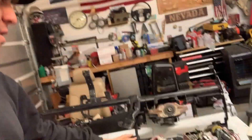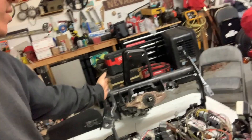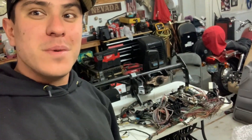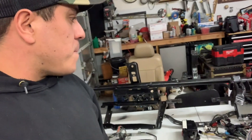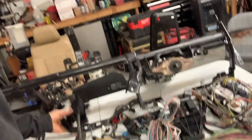Where I'm going to get started - like I always do, I like to start from the passenger side and work my way to the driver's side. It's all pretty easy until you get about right here, where it starts getting a little funky because you've got all the bells and whistles on the driver's side. My very first step though is we've got to mount the hardware - that's always the first step when doing a dash swap. Make sure you get the fuse box, the column, the column helper, the box switches, and the new fuel cutoff switch all mounted before you start wiring.